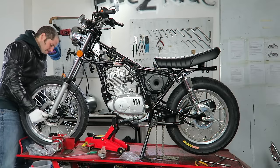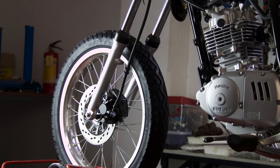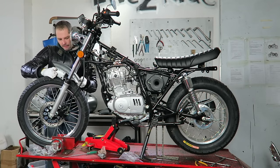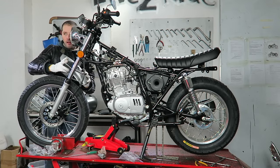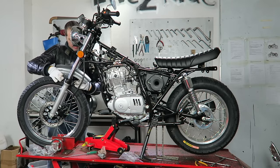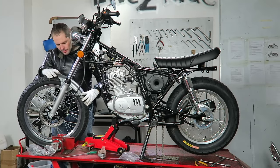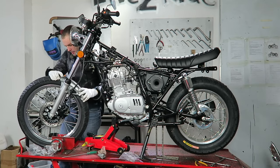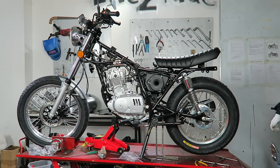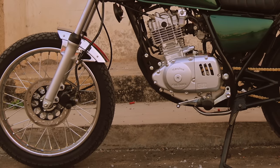After a little bit of a struggle the wheel's finally on and you have to admit it just looks so much better. It's up to you — you can leave the fender off if you don't want one — but like I said earlier it is better to have one, so we're going to put the modified fender back on. I don't have footage of the actual cutting of the fender, but for the front fender all I did was take a sharpie, figure out more or less where I wanted to cut, and ran a grinder along those lines. After that you just file off the edges to make it nice and smooth, and then I got an automotive paint place to paint them up for me. You can just rattle can it with spray paint as long as you key and prime it first since these are chrome — otherwise the paint will scrape right off. You can also leave them chrome if you prefer.